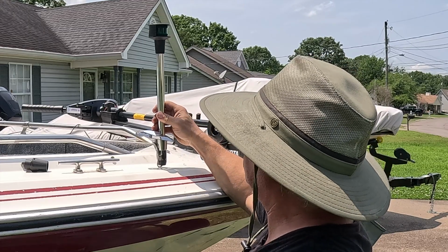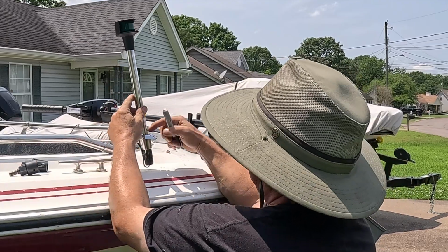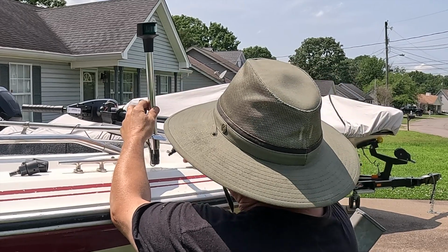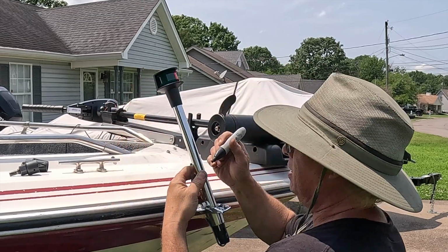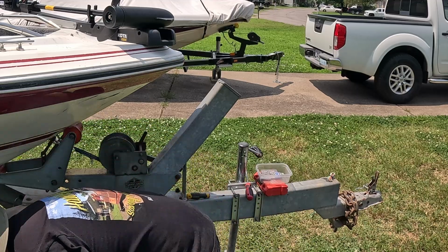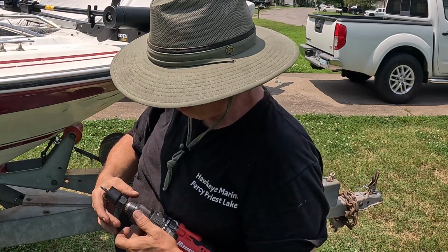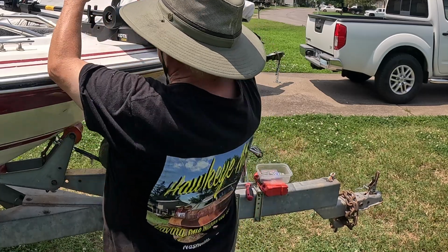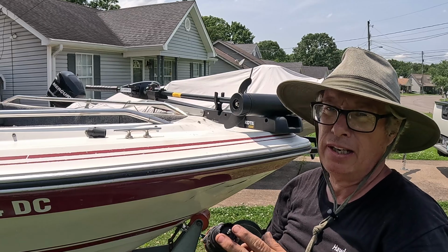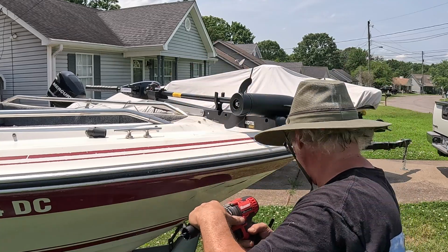While I was in there, I grabbed the oil Sharpie. And I like to stick it in the thing just so that you know which direction it's pointing. So we're just going to go right here and drill us a hole. It's pretty much that simple. But it needs to be at least 1.25 inches. Like I measured it in there, and you've got to have that big of a hole for it to slide down in there.